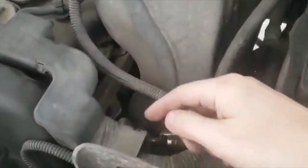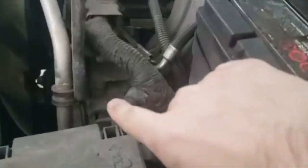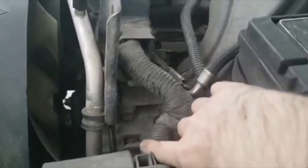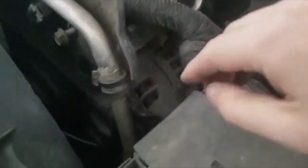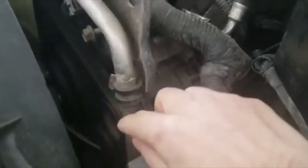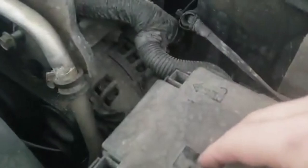The previous owner never put that bolt back, but I'll cover it anyway with tape. Once that's done — battery removed, fuse box removed, those two bolts removed — come to the front and remove the two bolts holding the alternator in place. Before removing the bolts you'll need to go to the tensioner and remove the belt. But by unscrewing the bolts it'll pop right out, so don't be scared.